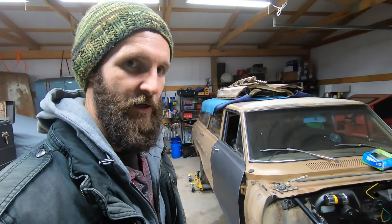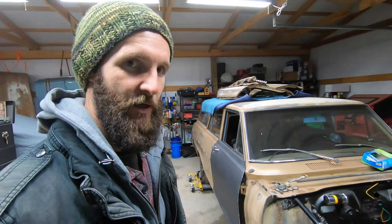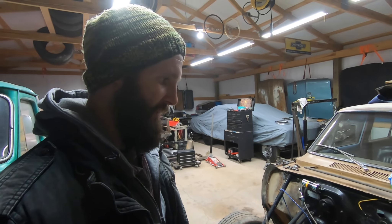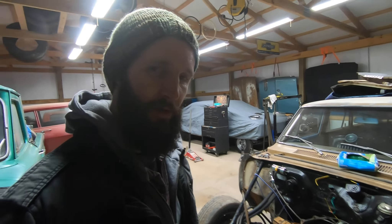I'm not worried about perfection or wires pre-cut to the right length. I kept all the factory harness I took out so I can pull my plugs for things like the windshield wiper motor, headlights, and marker lights. Since it's an aftermarket front clip I'm going to have to run the wiring differently than factory anyway, so we'll go generic and make it work. On brakes — it's already got disc brakes on it, so we're going to use what's there, maybe clean them up a little. There's some flash rust but overall they look pretty decent.